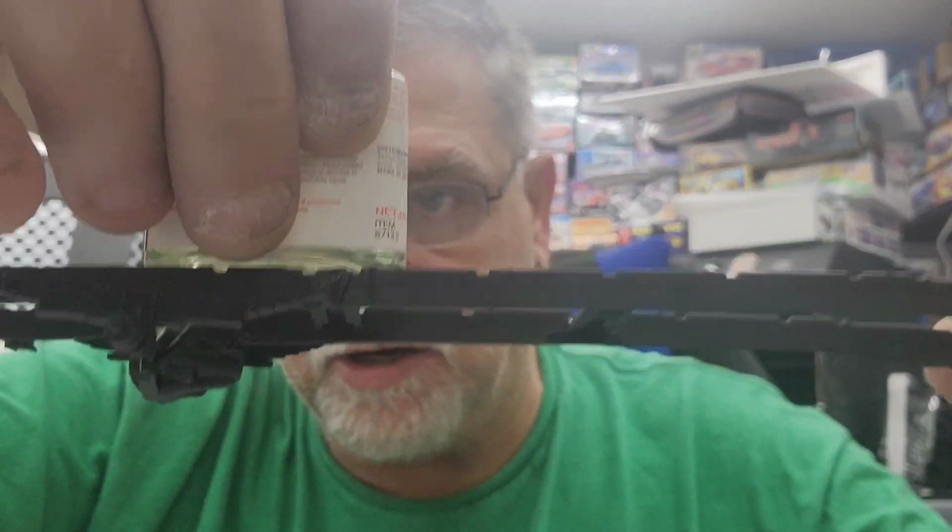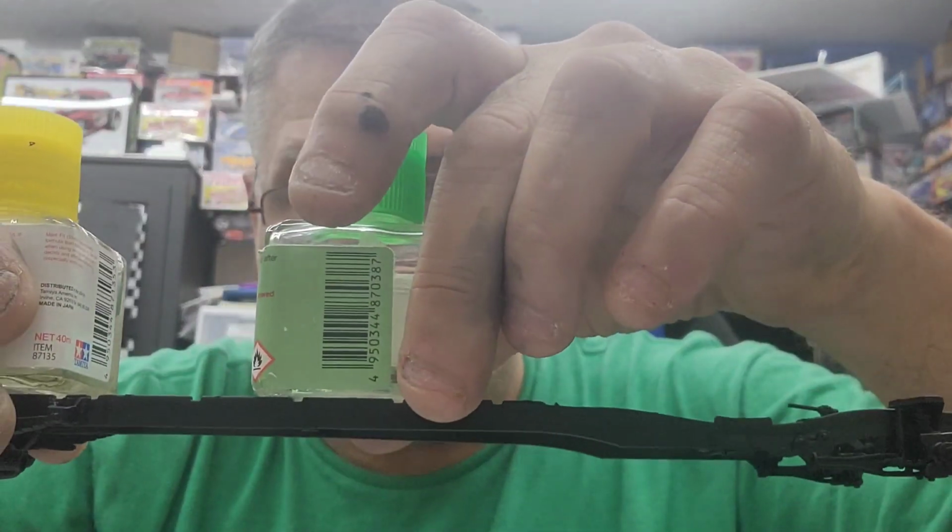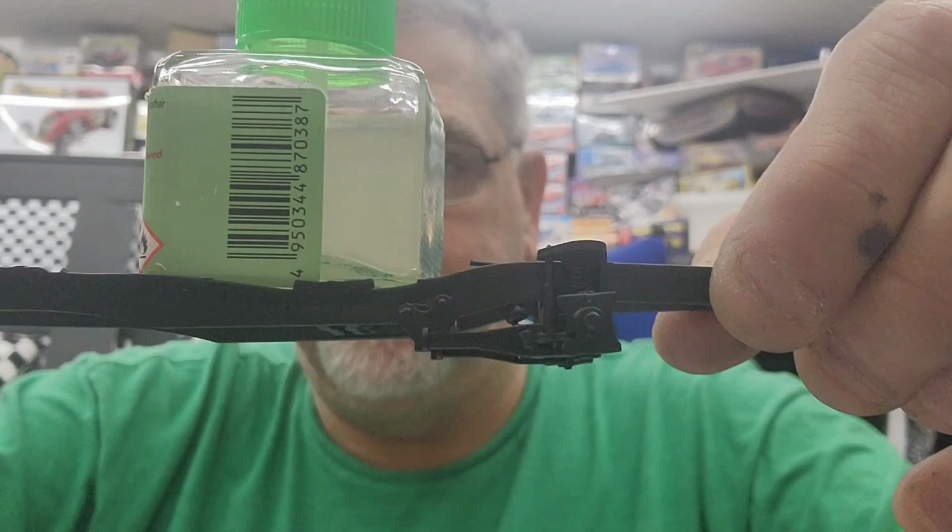I will put these on the frame. I know my back tires sit level, so I'll go ahead and I'll put that on there. And then I start with this one up here, kind of in the middle, so you guys can see. I'll start heating the frame a little bit, just the one side that's hanging up. I heat it not till it gets all molten and melty, but heat it just enough to where it's going to manipulate. Then I slide my weight forward. In this case, on this frame, it'd be right behind the front wheels. That should put enough weight to where that tire hits the ground.